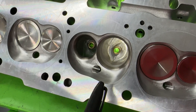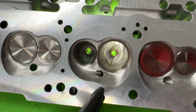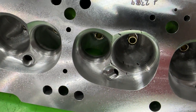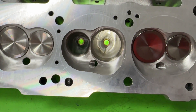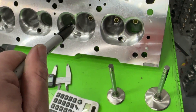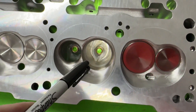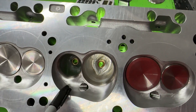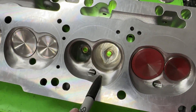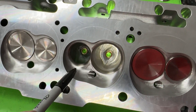The catch is that if you look at this chamber — I don't know the CCs, sorry about that — but if you compare it to the Trick Flow CNC chamber, this chamber by far looks bigger, there's no doubt about it. The Trick Flow one here is their CNC port at 190cc. This one initially comes with a 202 intake valve; this Hughes head has a 208, so it's a much bigger intake valve. The exhaust valve on this is 1.600 compared to the Trick Flow's 1.570 — so much larger intake and exhaust valves.